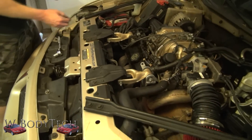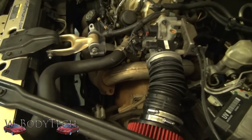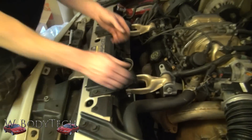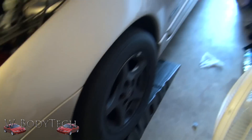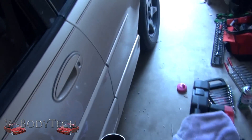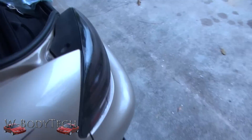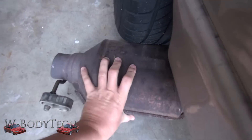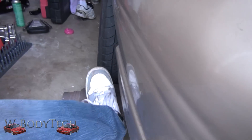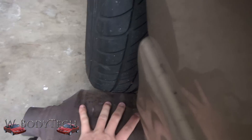So you're undoing your upper motor mounts. But before you do that, we've got to properly chock the car because it's on ramps. So we've got our certified wheel chock here — just kick that in like that.